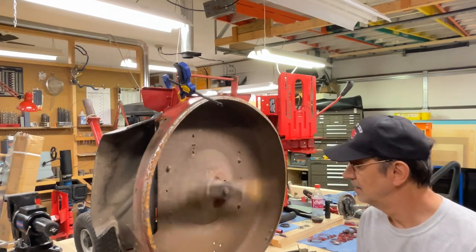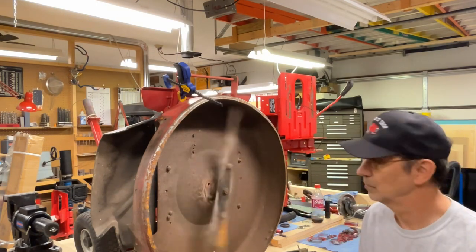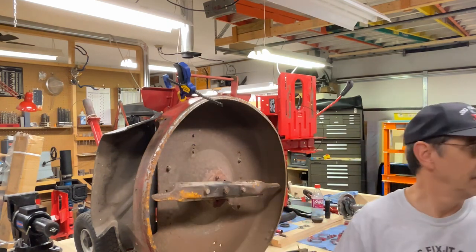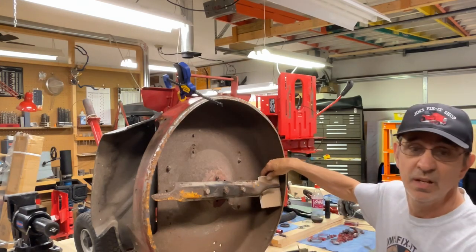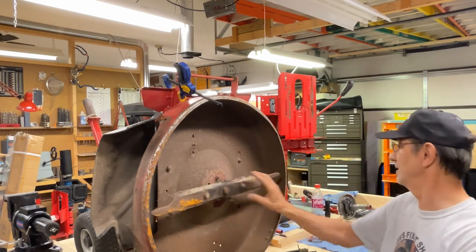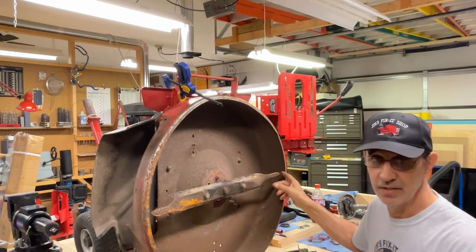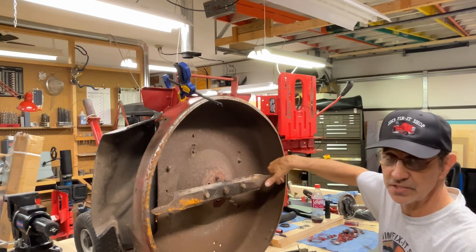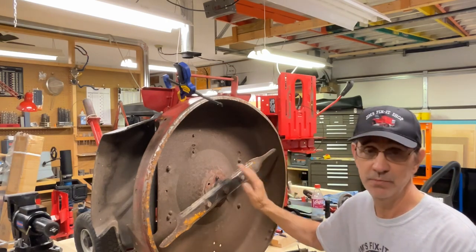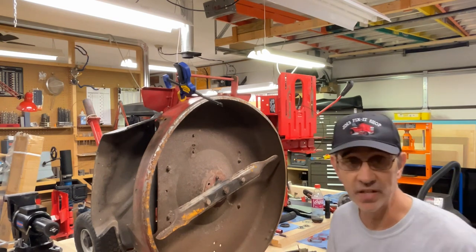Now this one — I'm saying I probably should put bearings in the spindle on that because it should not spin that freely. And if your blade looks like this one — there's basically nothing left to this blade. These are extremely dangerous to use on this machine. It's worn down so I've got almost an inch of clearance here. Snapper blades don't have any clearance — they fit up inside of this lip. That's what gives them the extraordinary vacuum power they have. This is a patented deck. Not many machines will have them, but you may start seeing them because the patents are pretty much all expired by now. Patents are only good for 20 years.